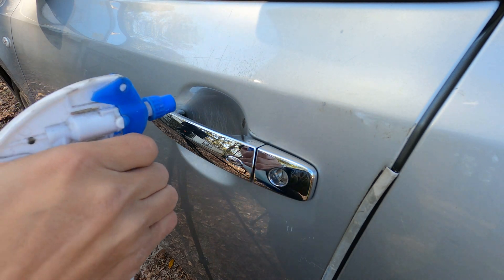If you haven't gotten the results you want after one pass, go ahead and add another small dime sized amount of compound to your pad and go in for round two. For most cases you only need two passes to remove 95 to even 100% of the scratches left by nails underneath a door handle. I did try to reduce the black spot, and it would eventually come out better if I focused on it more, however it is actually a bit through the paint, so continuing to work the area could cause more damage — so I left it as it was.